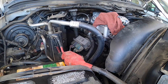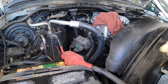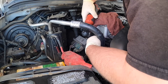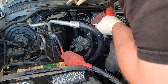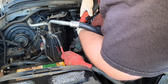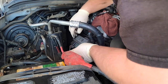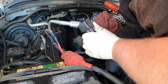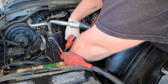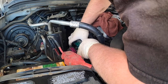Let's get the charge tube out. Now we're going to have to remove that bracket. We're going to need a 10mm. We need the orange for the filling tube as well. There's two 10mm bolts. We're going to unplug them by pushing on the tab right there — these will come right out. Then there's another 10. There's a stud out of the valve cover.